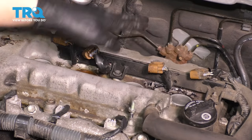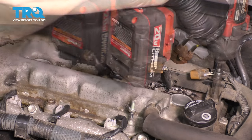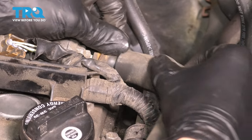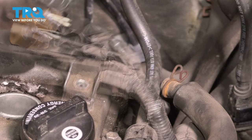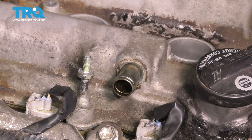There's a bolt and a nut holding down this wiring harness — let's take both of those off, 10 millimeter also. The whole stud came out on this one, but that's fine. Let's squeeze this clamp and remove the vacuum hose that's on here. Set that aside. Now we can get this out of the way. There's another vacuum hose at the front — move that one aside as well.